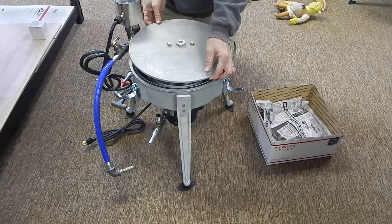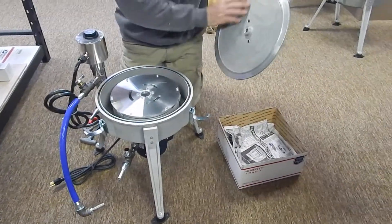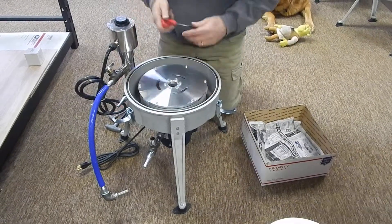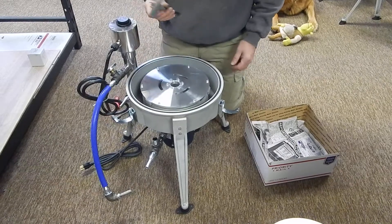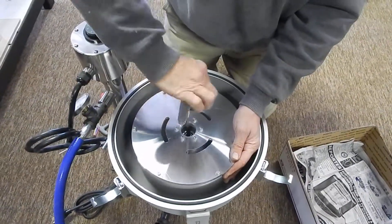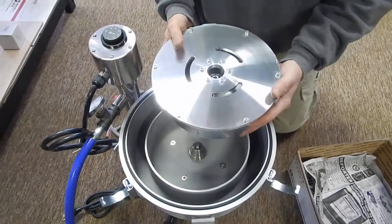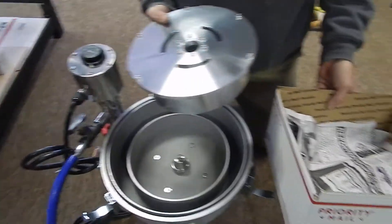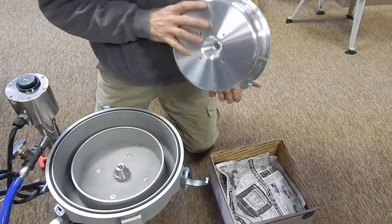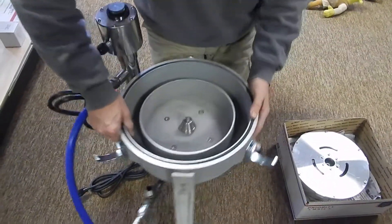There's residual oil here. Here's the bowl — we're going to remove it. You're going to take an 18-millimeter wrench, hold the bowl, put it in the nut, turning counterclockwise. If I'm using this bowl like mine, it's mounted on a tube. I have a cardboard box filled with newspaper. There are four holes and some will leak out — I've used the same box for a long time. This is the inside of the centrifuge.